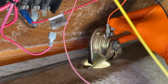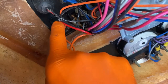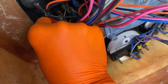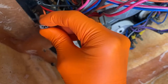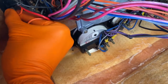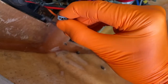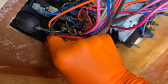In our case they look good. From here, follow the wires — they go all the way up here, this one right here — and what I found was this is extremely loose. So what I'm going to do is grab a pair of pliers and crimp this connection point just a tiny bit, which will create a much more secure connection. This comes on and off very, very easily, so it's interfering with the electrical connection. All I did was take a pair of pliers and carefully crimp this just a bit, and I'm going to re-secure it to the connection way up top.